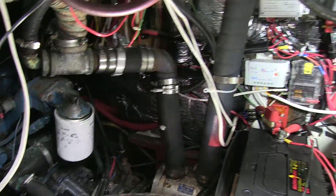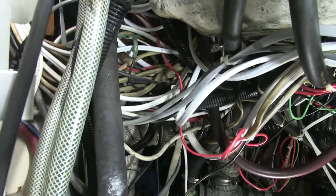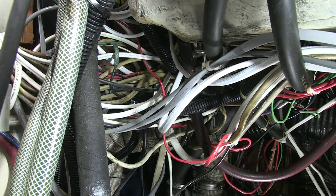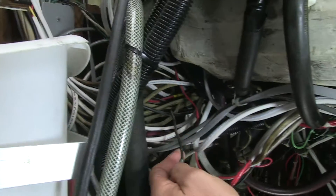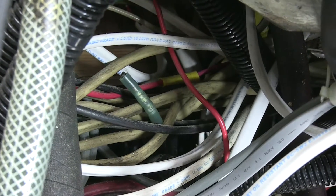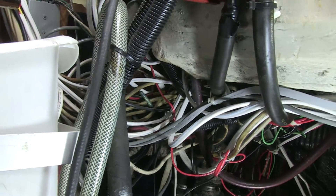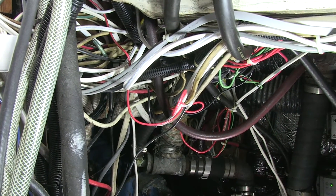As we back away a little bit, things like this are obviously not great and make you wonder what everything does. Something that worries me right off the bat is a wire that is simply gone but hanging — and you can see another loose end of it just sitting there. It's really essential, especially when you're going to be troubleshooting, to make sure that all loose wires, if they can't be removed, get labeled. That's a really good way for an owner to stop worrying about certain things.